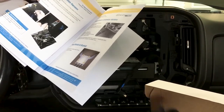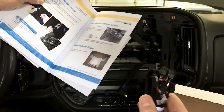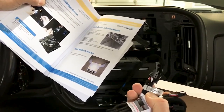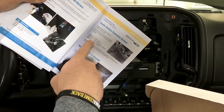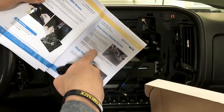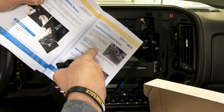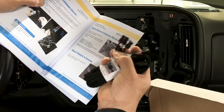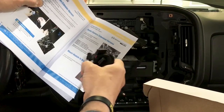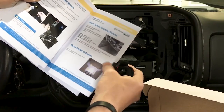The harnesses are labeled from the manufacturer as camera one, two, three, and four. Camera one is the driver's door camera, camera two is the passenger door — just plug in accordingly. Camera three can be your front camera and/or trailer camera, so if you're doing a front camera, there's a step to activate it once powered up; plug your front camera into camera three. Camera four is always going to be your rear — tailgate, cargo, fifth wheel, or your wireless camera with the switcher.